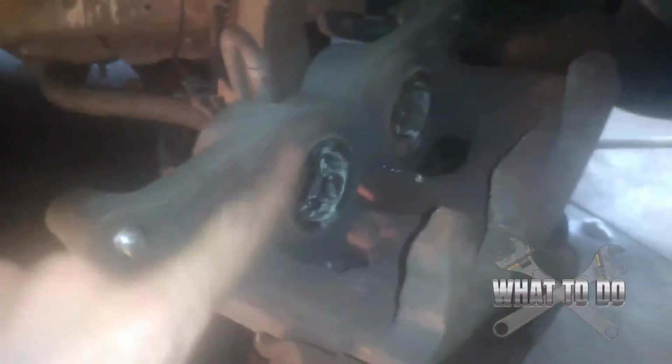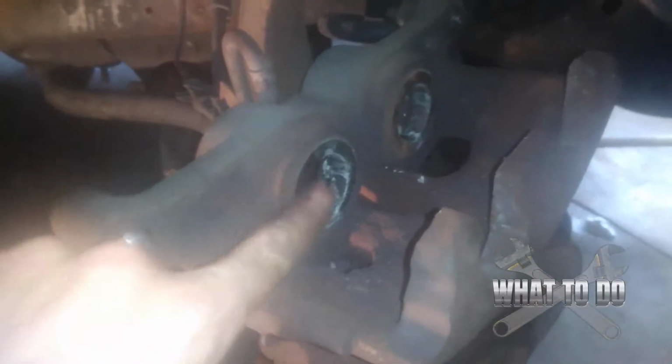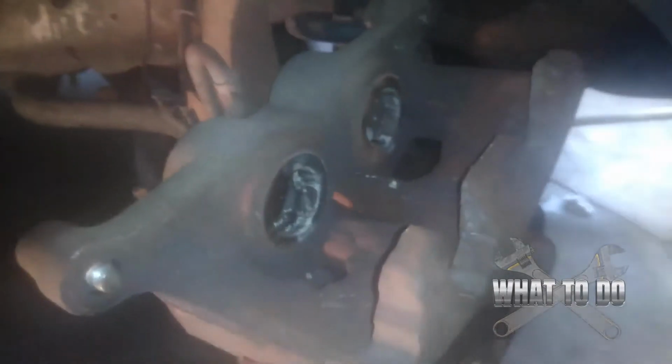Now you can go ahead and pry this pad off, and you'll know this is your back pad when you see them in the box, because this is the one that will have these clips on it. Okay, but take note of the direction that was going as well, and you can see this pad was pretty bad. And you want these really, really flush, so make sure they're flush, or put that pad back on and compress them more, because this will cause you problems later when you're trying to put this back on if they're not recessed in all the way.